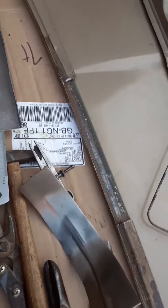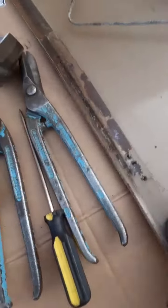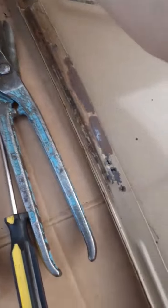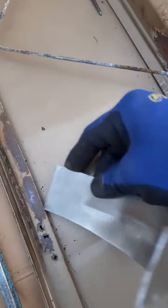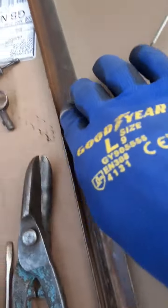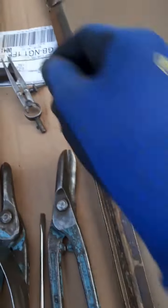I can't really do any more banging tonight because it is getting quite late and I do have neighbours — I'm working in the street. So what I'm going to do is put some rust treatment in here. I've scraped it all out using a piece of steel right in here. You can see there's bits coming up, so I'll give it one more scrape, vacuum it all out, then get rust treatment right in and rust treat everything before even thinking about welding it.